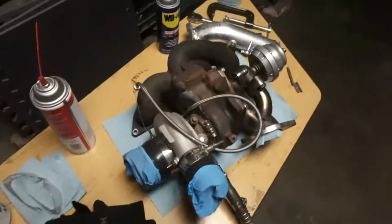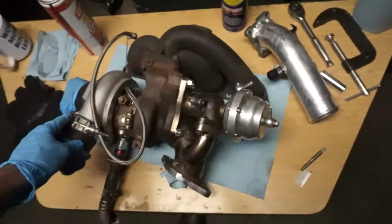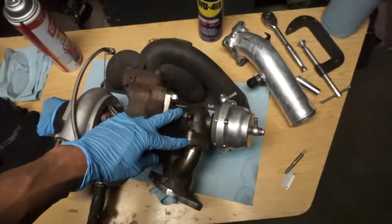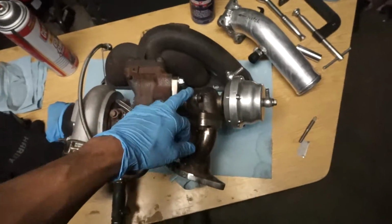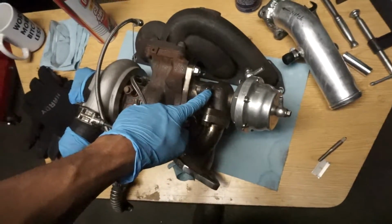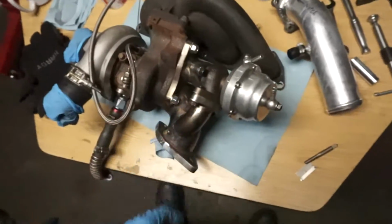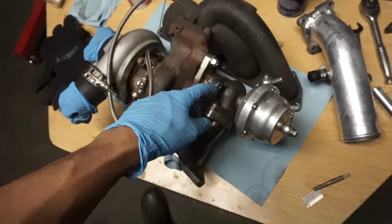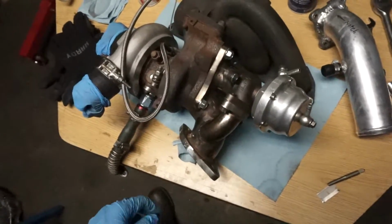Fast forward a few days from the intro. Here's my turbo setup. This is what I've been able to get done since I got the engine. I need to replace the exhaust gaskets on the wastegate as well as the main one. This one was leaking and I replaced it with new tile ones, and the hardware needed Allens because the other ones were hex. I don't remember how I got them on the first time. That was probably like 4 years ago. So I had to weld a socket and a wrench combo thing, but got Allen heads on there now.